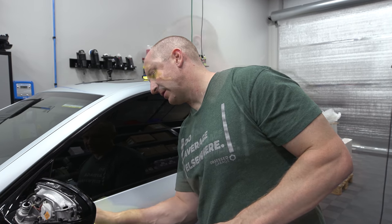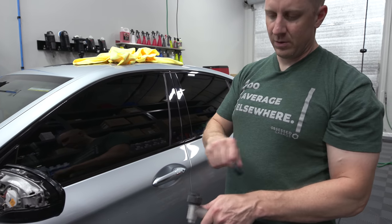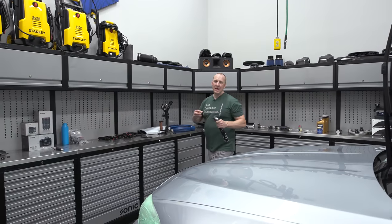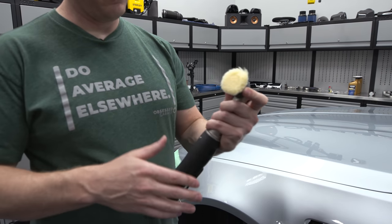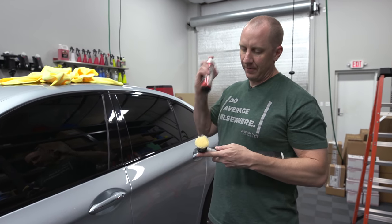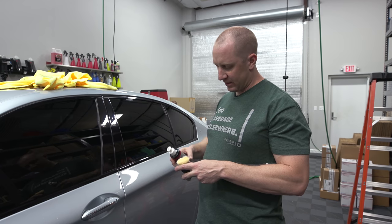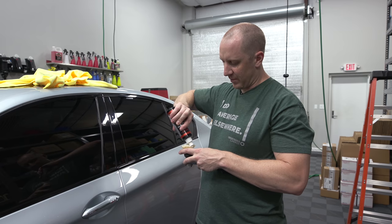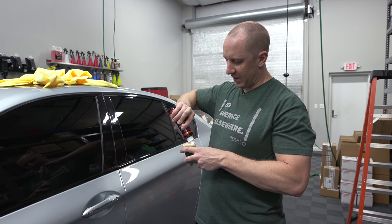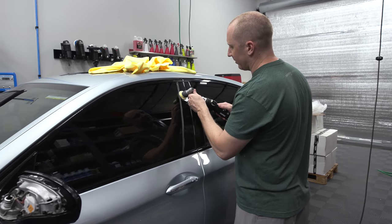That's why we're gonna be breaking out our number 39 for sure. Wire's 39. So we're gonna take this puppy off the Nano and we're gonna go wool, medium wool. So what I found, tried a bunch of stuff, medium wool, 1-inch pad, Jescar correction compound for our black trim. Got it pretty clean. And then what I'll do is I'll just finish it with our bigger yellow finishing pad when I'm finishing up the project here.